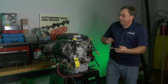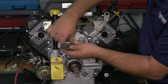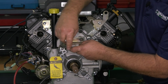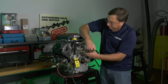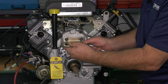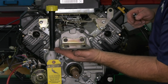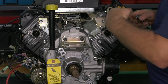Everybody thinks all you got to do is bolt the bracket to the block, bolt the engine up, run the two bolts into the bottom of the muffler — shouldn't be any kind of problem after that. I'm going to start these bolts in and show you where the problems lie. I'm just going to run these in to almost snug so the bracket is still loose. The bracket is not perfect — it can move a lot. Typically people will mount the bracket, leave it hang, mount it at the bottom so it's as far away from the muffler as it can be. You bolt the muffler up, draw the bolts up in the bracket, pull them up tight — well that's pulling pressure down in the muffler and that's what causes the breakage right near the flanges.